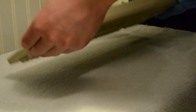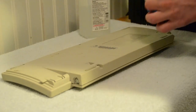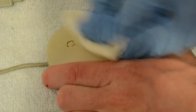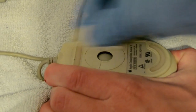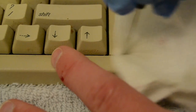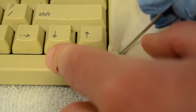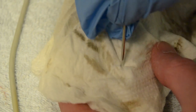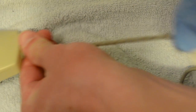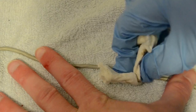The first thing I do before any disassembly is take some alcohol and a paper towel and spot clean both the keyboard and mouse, trying to get any areas with scuffs, scratches, or high concentrations of dirt, and really just get it as clean as possible before I take anything apart. For small areas like this little divot, I usually just take a small screwdriver and get into it that way. I also did the same thing for the little Apple logo on the mouse. I then took out the trackball and cleaned it as well. The mouse's cable was also dirty and I had to spend a good amount of time wiping that down with alcohol.